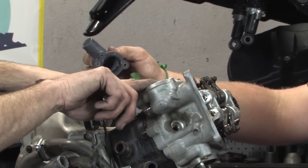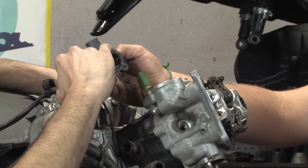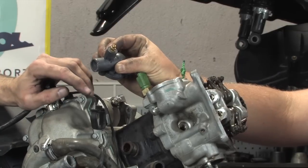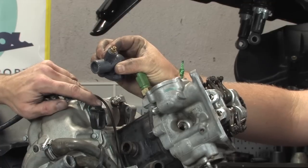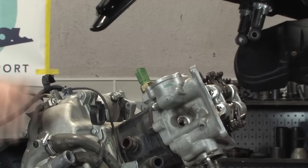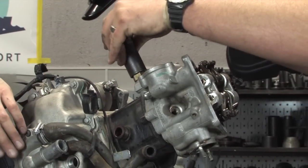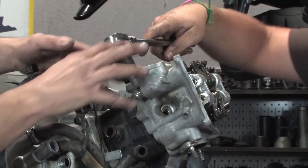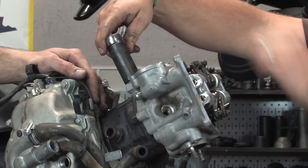And it actually opens up that passage that we talked about needing that extra O-ring. You can see it's right there, that little passage. You unscrew this two or three turns, and opening that passage allows the air to come out of the top end of the motor. When you change your coolant, these engines, because of the cooling hose arrangement, are prone to cavitation, which is basically air pockets in the cylinder head or in the water pump. And that bleeder screw allows you to bleed that air out.